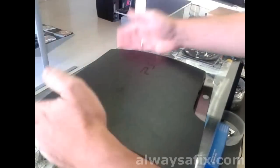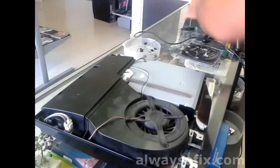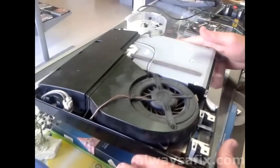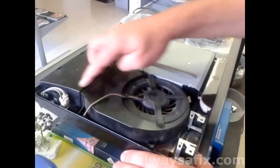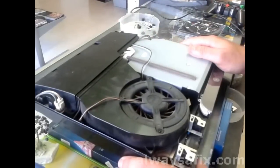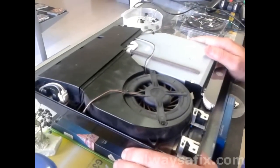Welcome to the back. While you've got the machine open, it's a perfect time to make sure that your fan is all clean and the heat sink here is all clean, because overheating is the leading cause of damage in these game consoles.